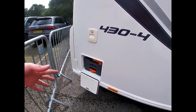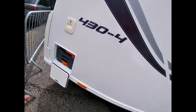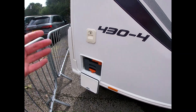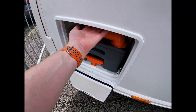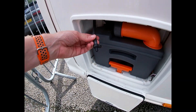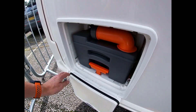When you're not using your van, make sure you're not leaving anything in your flush tank or in your cassette. We don't want to leave any water or anything that could potentially freeze and damage the van. So empty that and also drain the flush tank — there's a little stopper we can pull down, pull the stopper out the end, and that will drain down our flush tank.